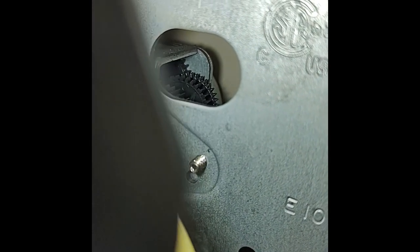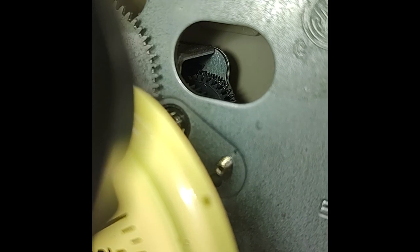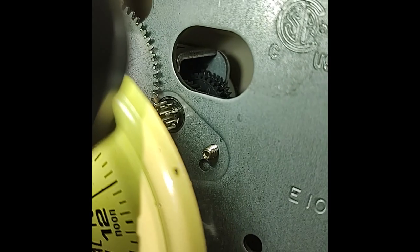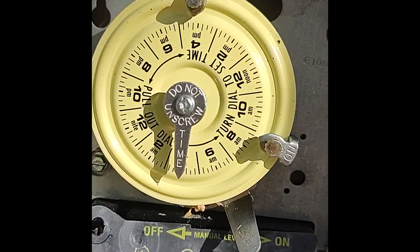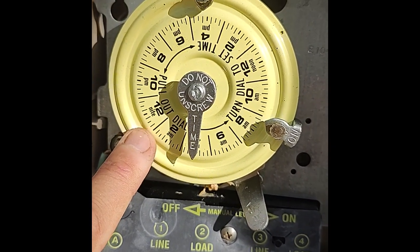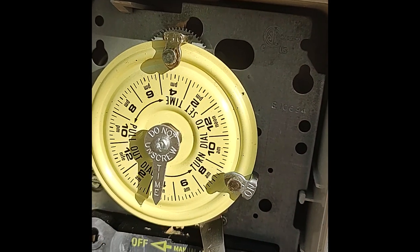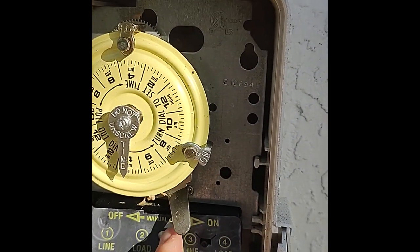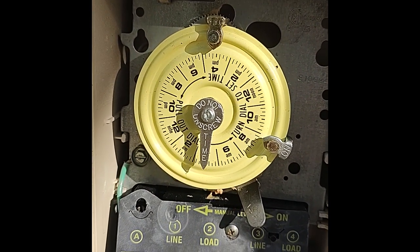I've been trying to get an angle. This is a perfect example of what I'm referring to — the timer's on and the gears are not moving at all. I'm hoping you can see that and I'm getting a good angle. Those gears in the back are stuck. This timer hasn't moved at all. Sometimes it's stuck and not rotating at all; other times it does rotate but just bypasses the on and off. So yeah, this timer needs to get replaced because power's on — I've got power coming to here — but the gears in the back are not moving.